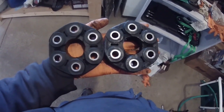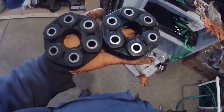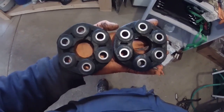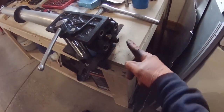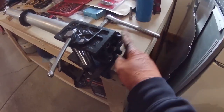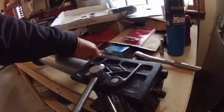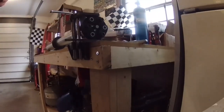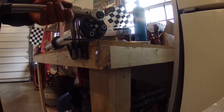Here's what they look like side by side - on the left is the old coupler and on the right is the new coupler. The old ones don't really look bad at all. I'm just replacing them because I don't know the age. I have these three in here now pretty good. It's time to torque them. Because this is a manual transmission, they get torqued to 66 foot-pounds. I'm going to start at a lighter torque - probably start at 30 and work my way up.